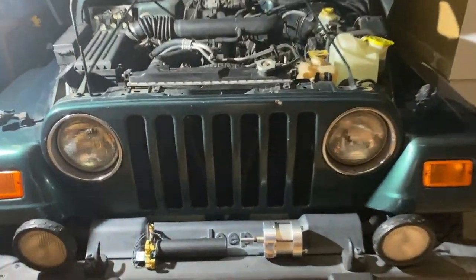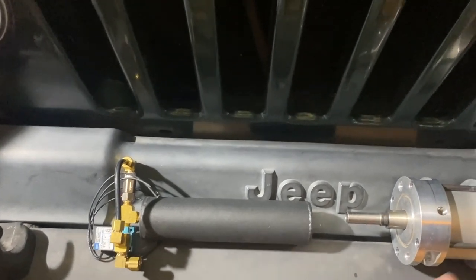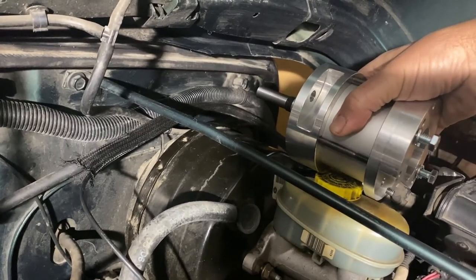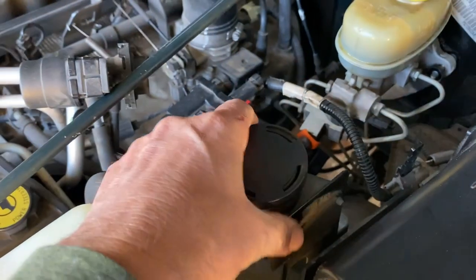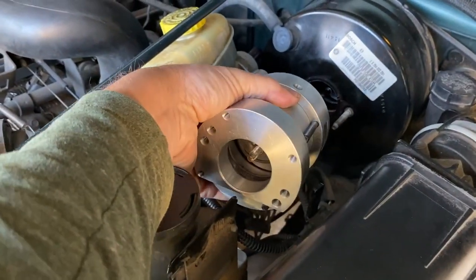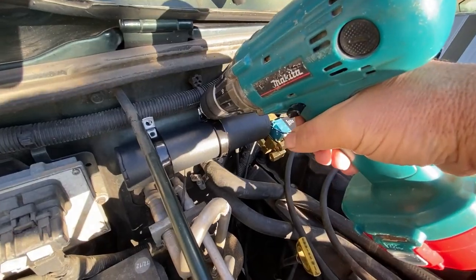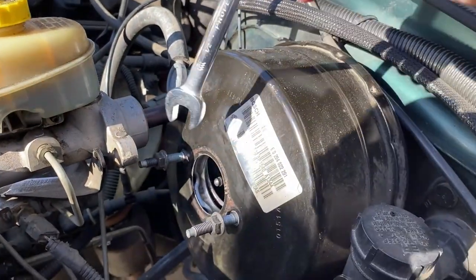Now on to the Jeep. This is my Wrangler, and this is my M&G Engineering braking system. And the breakaway system to make sure that if your Jeep comes apart from your RV, it will stop automatically. This gets installed in line where the master cylinder is right now, pushing the master cylinder back about four inches. I had to remove this whole assembly. So now with this pushback, I can pull off the master cylinder and get it out of the way. Our wonderful new M&G unit fits right in there. I've decided to put the breakaway protector here. The vacuum booster studs have to be shortened to 7/8ths of an inch.